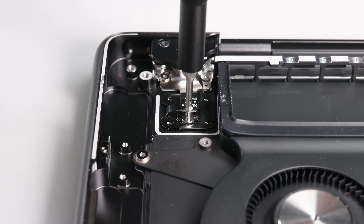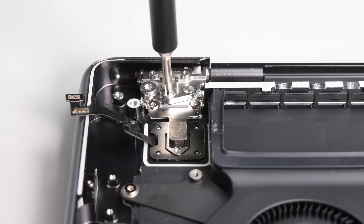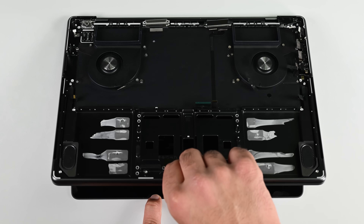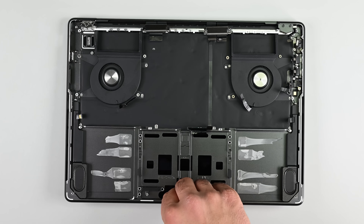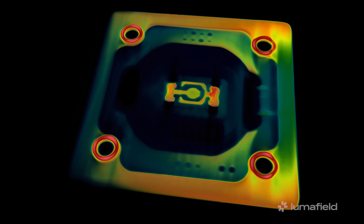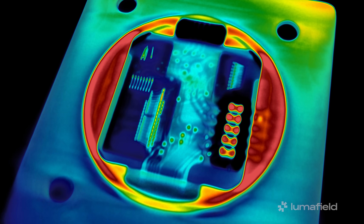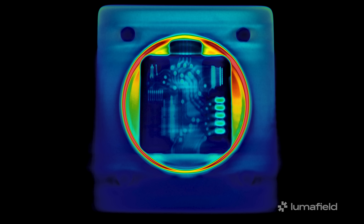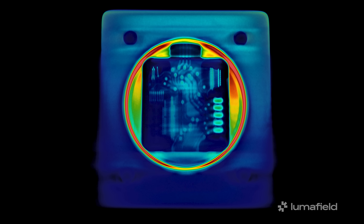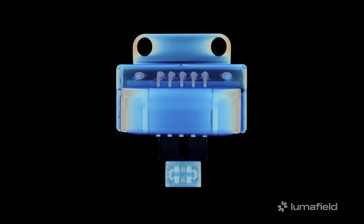Taking a closer look at that Touch ID sensor has the wheels in my head turning. Components like the Touch ID button and the new camera button on the iPhone 16 are welded shut, so we don't usually get to see what's inside. But thanks to LumaField's Neptune CT scanner, welds are no longer a barrier. We have a simple switch on the reverse side that when pressed closes the circuit and presumably powers the device on. On the other side we have a circular glass window and a tiny IC buried in here pairing the component with the SOC. A few layers closer to the surface sits a very thin capacitive sensor that measures the dips and ridges along your skin — that gets translated to a two-dimensional map of the skin on your fingertip, better known as your fingerprint. That's super neat.